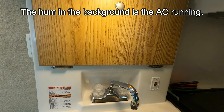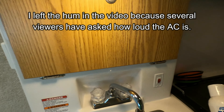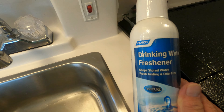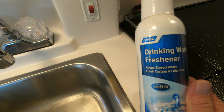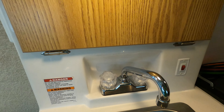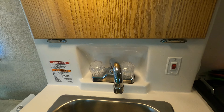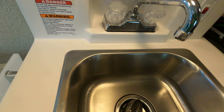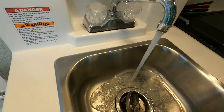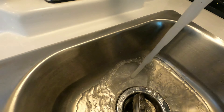We finished flushing the water tank and refilling it, and now we're going to flush the system on the inside. One thing to mention: several manufacturers make what they call drinking water freshener — this one happens to be Camco. Just so you know, the active ingredient is sodium hypochlorite, which is the exact same thing that's in household bleach. So if you want to spend that money you can, or you can just use bleach like I did. Casita just recommends using bleach. We're going to turn the water pump on, turn the cold water on, and flush it until we smell no more bleach.